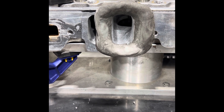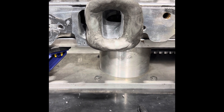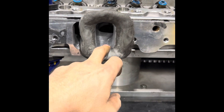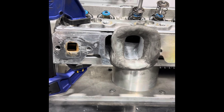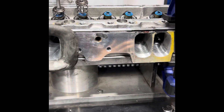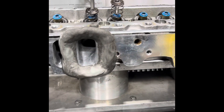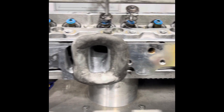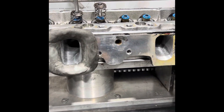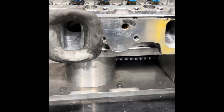So I don't kind of like to lose flow numbers — not everything — but I said, you know what, let me see if I can try to gain those numbers back. I haven't tested this cylinder head here and then went there to see what the difference is between this bench and his bench. But I can check my difference between what it was flowing before on this bench — same port, same everything, same gasket, same features, same clay, the whole nine yards.